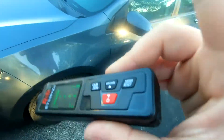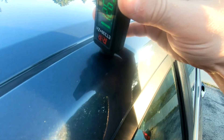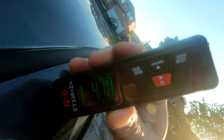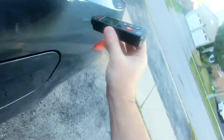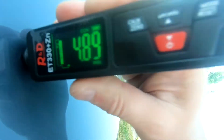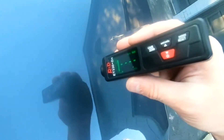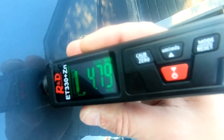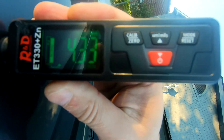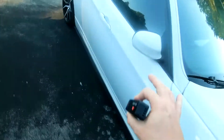Now let's test this on this car. This entire vehicle is obviously factory, so let's see what the thickness is on the Toyota: 4.7, 4.4, 4.8. Let's try the hood — it should be higher because this is what people see. 4.8, very close. Let's try the roof: 4.4, 4.0. This has got a pretty good factory finish from the machine, whereas the other one is obviously repainted.